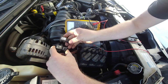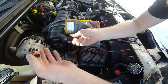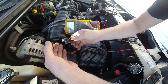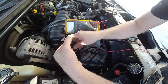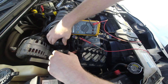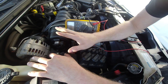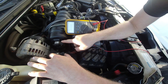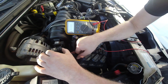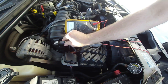I'm going to grab a new sensor — hopefully I have one in my bin of used parts since it's an old enough car. I didn't cross any part numbers yet. It looks the same, but it doesn't mean it is. This one could be from a boost reference type scenario with a different range built in. But all I want to do is make sure it works. All MAP sensors with a five volt reference that are no-boost type are pretty much all the same — same ranges, same connectors. It has the same connector, so we're going to plug this in and see what we get.